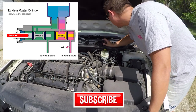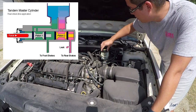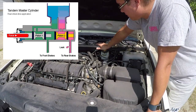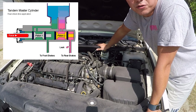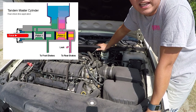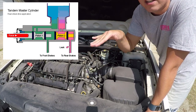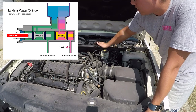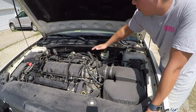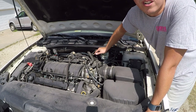If you have leaks in your brake line, that could also cause a similar kind of problem, because as you press the brakes the brake fluid will leak out wherever that leak is and cause your pedal to just keep going. The only difference is a bad master cylinder sends the excess brake fluid back up into the reservoir, whereas a leak in the actual system means the brake fluid goes out somewhere else.